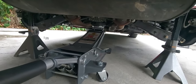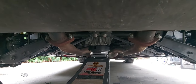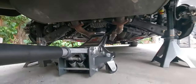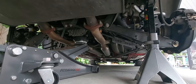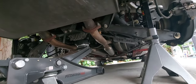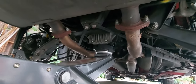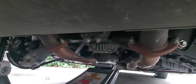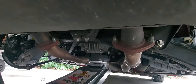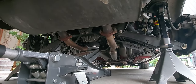I'll show you where I've placed the hydraulic jack, which is right under where the differential is located. There is really no information online — no documents, no pictures — so this is the main jack point. Make sure you put a nice thick rubber pad right on top of your jack plate so you don't damage anything. I'm using a very thick hard rubber to stay safe. The jack point is between the two exhaust pipes.